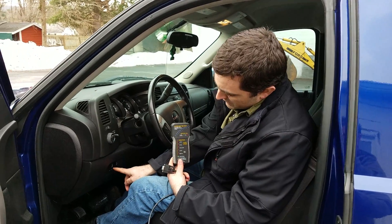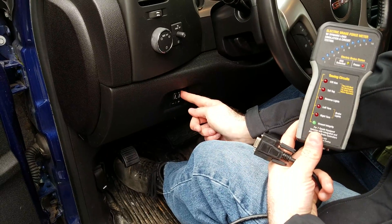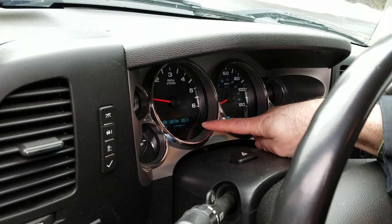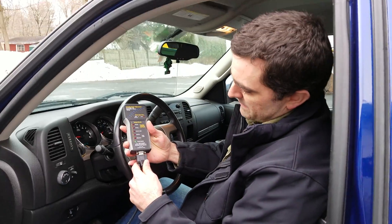If you're familiar with integrated brake controllers, this is a telltale sign — and if you're not, it's a slide bar plus/minus setup. If you look on the dash here you can see zero output. I put my foot on the brake and it's basically giving me no output. So let's connect this tool and see what happens.